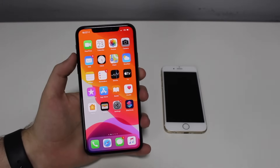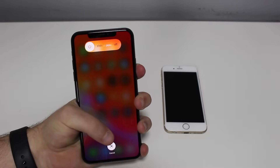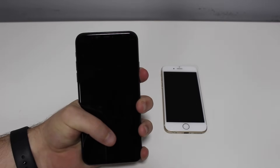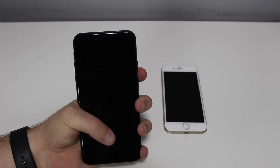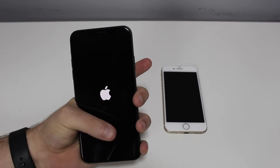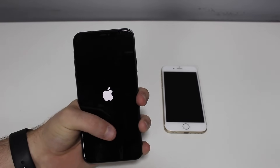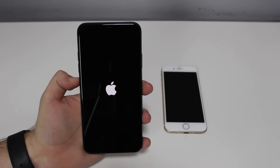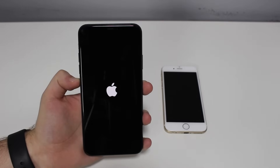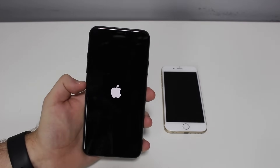So in action: volume up and let go, volume down and let go, then press and hold the side button. I'm just pressing and holding the side button — no volume keys after that. You just press and hold one button, which is the power button. You see the Apple logo, you let go. As soon as you see the Apple logo, release — because if you keep holding, that will make your iPhone just turn off, and that's not the idea. The idea is to force a restart — turn off and turn back on.